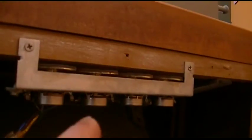Let's see. Okay, so on the Magnavox, the circuit breaker was open, so I bypassed it. But I got a fuse here anyway. I'm also going to delete the tuner and put fake knobs, and I'm going to pull these knobs and drop them down inside here so people can't turn and twist and push on anything.